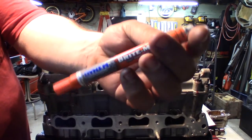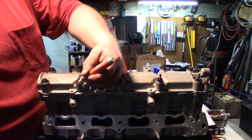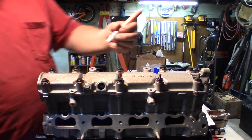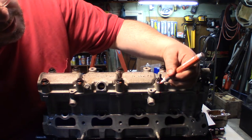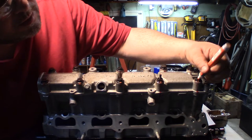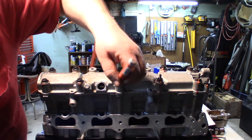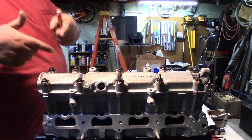So what you want is one of these bright mark paint markers. I'll put a link to it down in the description. But then just come here and make a mark on your bolt and the engine, like so, on each of these. And then you'll know when you've turned it 90 degrees because these marks will not align. And each one of those has a mark. It's very visible. I let that dry, and that way if I'm wondering, did I turn that one or not, I can quickly see if the marks line up.